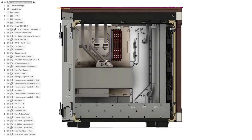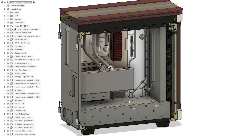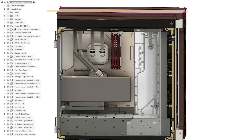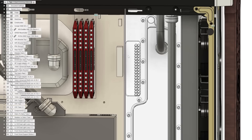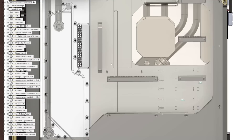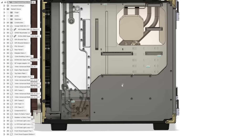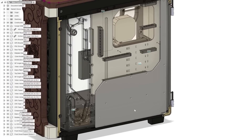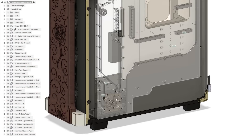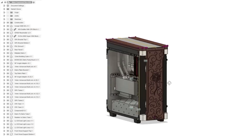We're also going to be making a cover here — it's going to be covered in the woodwork section, made out of plywood, and then on top of that we're going to be doing some lovely leatherwork, which should really tie in all the themes. We've got the radiator sitting in the front and then all the tubes running from all the different parts. One of the cool features is all the cable management — the 24 pin going out through here, and then an 8 pin and a 6 pin going from the GPU in a fan arrangement all the way over to the sides, flowing to the back through this panel to keep everything nice and neat. There's obviously going to be a whole load of RGB stuff back there, plus a little pump mount for the D5 pump that we took apart in the last video. So that's enough of that — let's get this toolpathed up and put it on the machine.